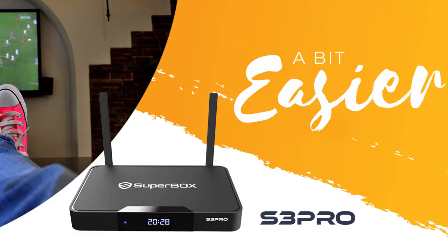The next step is how to pair your Superbox remote to the box. This remote supports both infrared and Bluetooth. When you are not connected to the box, it can work when you aim it at the box because it's an infrared remote. But only if you pair the remote to the box with Bluetooth can the voice control function be activated.